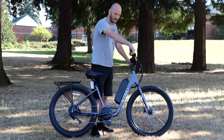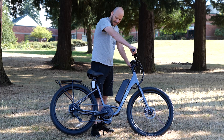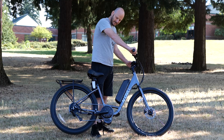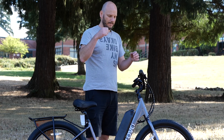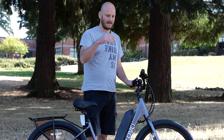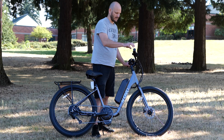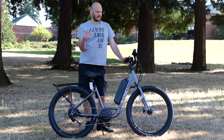He also wanted a full twist grip throttle. This is the twist grip throttle and it's nice because it has really good actuation — I can make it go really slowly and gradually. The stock thumb throttle is more of an on-off with like three degrees of range. This twist grip has really good gradation, so if you're looking for full control this is nice, and it's like a $25-$30 upgrade. Unless you want to go full-on with the Pacemaker throttle, but that's well over a hundred dollars.